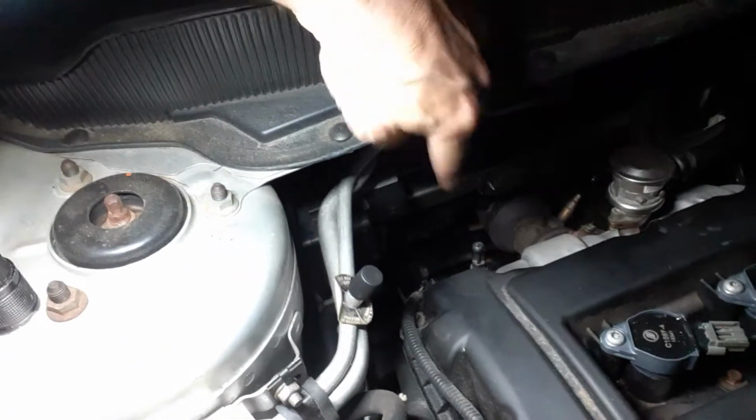All right, now I've already got the pulley off. It's down there, 3 bolts and a 10 millimeter head. Best thing to do, leave the belt tensioned. Break the bolts loose, go from underneath, it's easier to get to. And then go ahead and drain your coolant as much as you can, and then take the bolts loose on the water pump, pop that loose while retaining maybe 1 or 2 bolts in there, let the rest of the coolant drain out, then you can get it off. Probably best to do is either pull it out through up here or underneath. I'm thinking up top. But who knows at this stage.